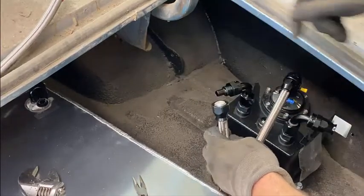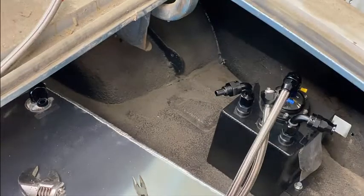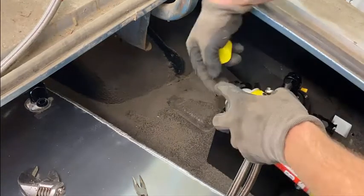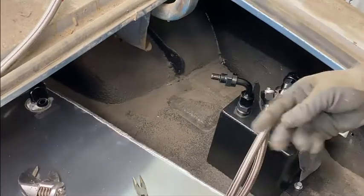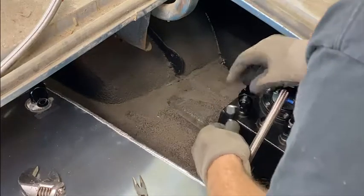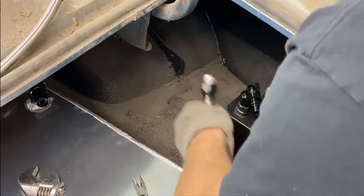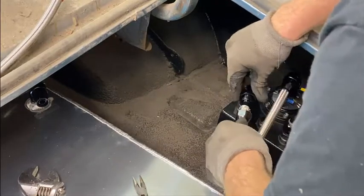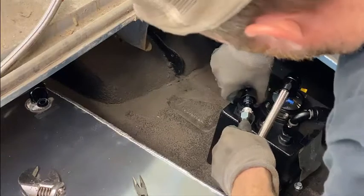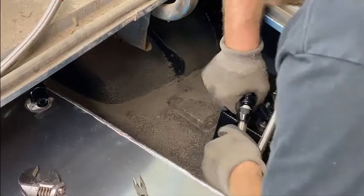Let's screw it back down here. Get it ready. We can lube this up. I got some PB Blaster here. Again, just like before, you can use spit, you can use whatever you want. Just needs a little bit of lube on there to help get it through that PTFE. Just helps the process. All right, so get your best angle. Again, this stuff can be ridiculously stiff to work with. Get your best angle that you're gonna get it on there with. I'm gonna tighten that one up. Give her a push. There, it clicked once.